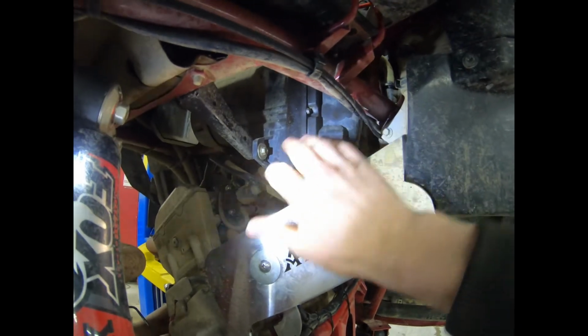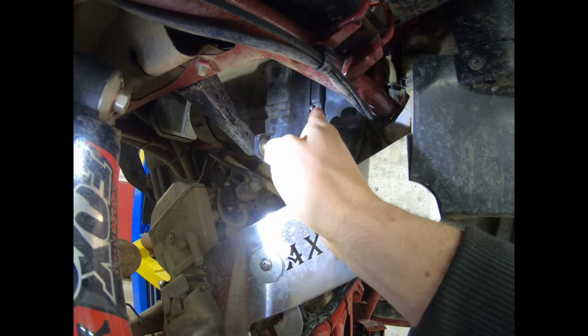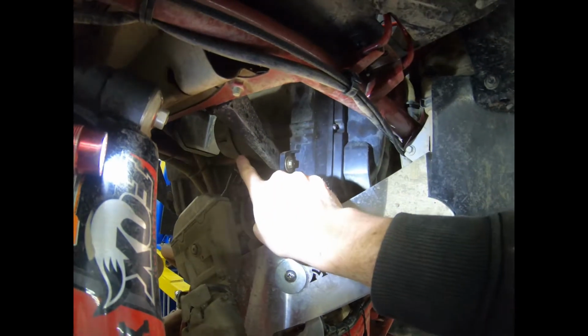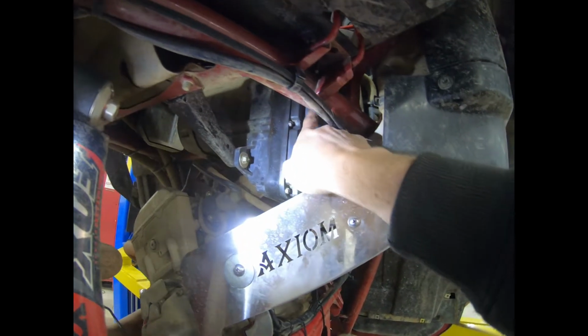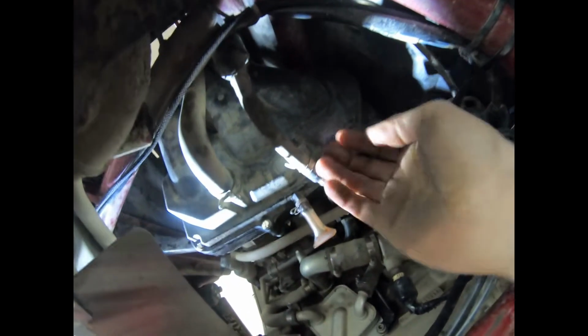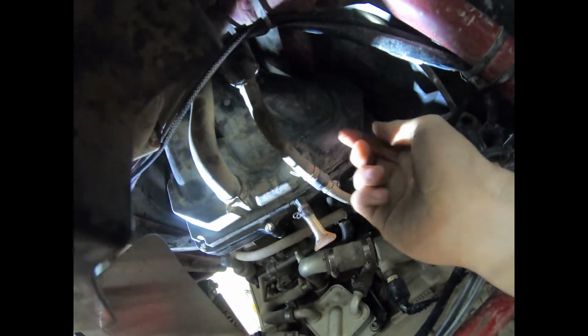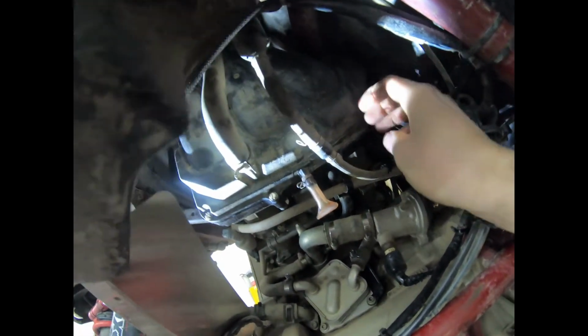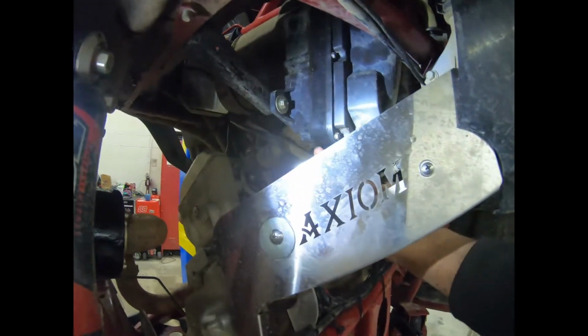But they make them in different colors if you want. Anyway, what this does is it actually moves the hat out. From your air filter, you've got your primary filter up there, and then your secondary filter over here. Air's pulled in and then pulled down these tubes on each side. So 3 cylinders, 3 tubes. And then inside this air lid are 3 Venturis. They're rubber and they connect to the throttle body tube, which is right here.